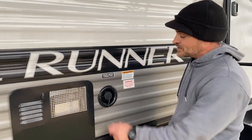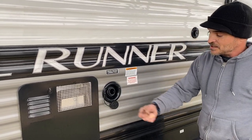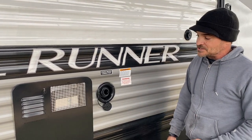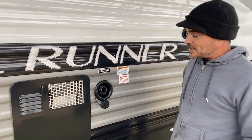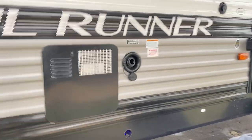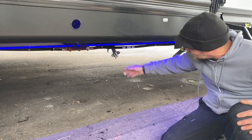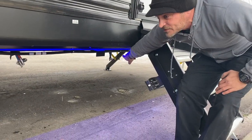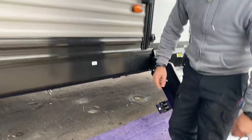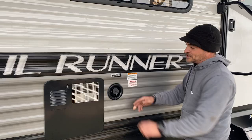Fresh water is on the passenger side for this series — it's normally on the driver's side. Simply set your water hose in and turn the water on about halfway. We don't want to go full blast because the tank can't handle that pressure — it will expand and you'll start causing damage. Just turn it on about a quarter to halfway and let it fill up until your overflow tube starts draining down. All of that is located up underneath here. We've got our low point drains — blue is for your cold, red is for your hot water. Up underneath the step is a single blue, which is your fresh water tank drain. Whenever you're done with the unit, you don't want to leave water sitting in the tanks; that will be how you drain your fresh water tank.